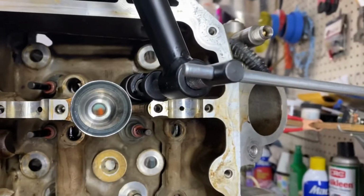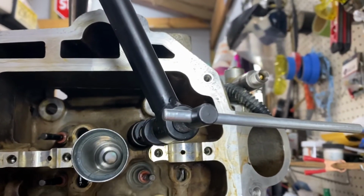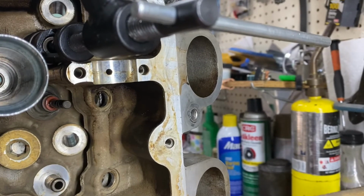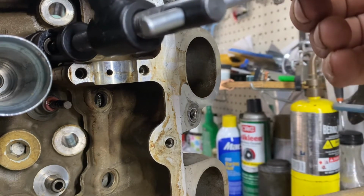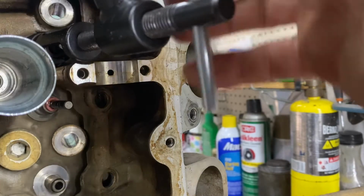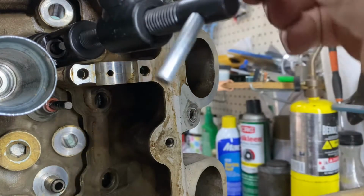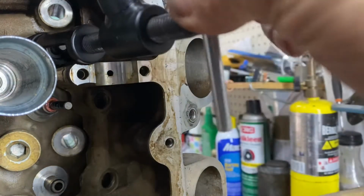I don't have the best video equipment, unfortunately. I'm working on it. All right, here you go. So what I've been doing to combat that is, as I'm drawing the spring back up again, just keeping an eye on it and not letting it knock the keepers out of the way. Just be a little bit careful as you go.